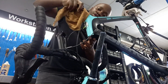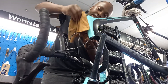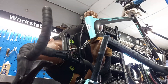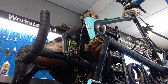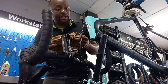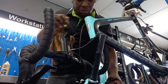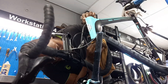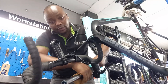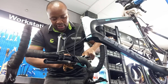You can't afford to ride your bike with a squeaky headset or with a shaky headset. Just make sure that you do it properly. We are removing all the grease — before we apply the new grease, we must make sure all the grease is removed. On the fork as well — let's make sure you wipe down all the grease.